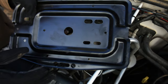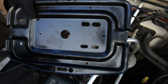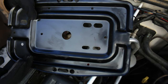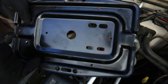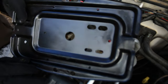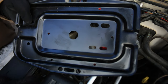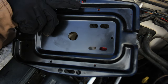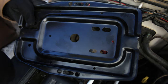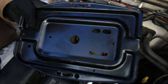Here's the new tray — right off the bat you'll see the shape is a little bit different, but all the mounting holes align so you won't have that problem. If you have the temperature sensor, there's the hole for it, so you're good there. The biggest thing is you have these slotted holes here which you need for the J-hooks to go in and grab. The reason they're slotted is so you can slip the J-hook in and then twist. That's what's really nice about the factory one — you can loosen them, twist the J-hooks, and just slip the whole bar out. No funkiness like the universal kits.